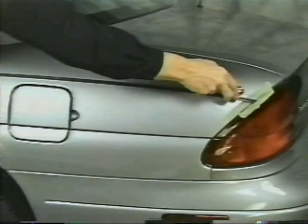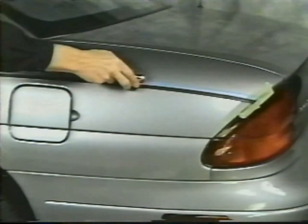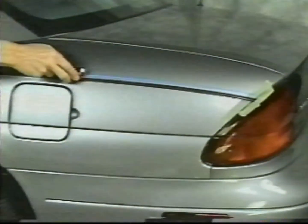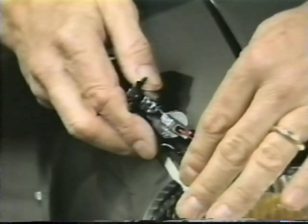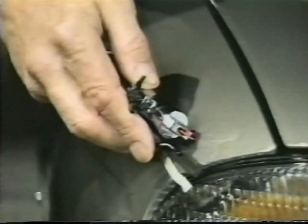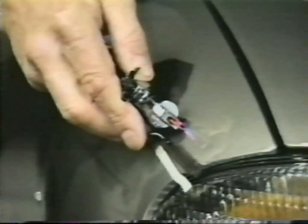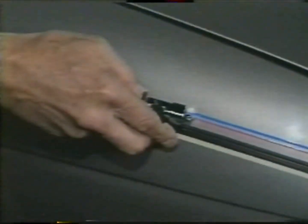If you have a second magnetic guide, you can proceed to the other side of the car without delay. To begin a second line in a point with the original line, readjust the guide arm for the second stripe, place the guide arm in the magnetic guide track, and slide the end of the magnetic guide up to converge the two lines and begin striping. This second stripe can be of a different size and color.